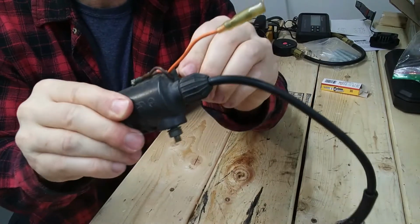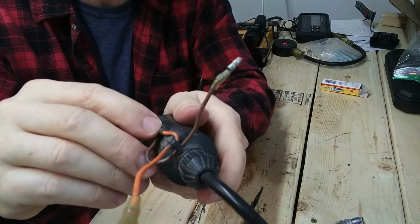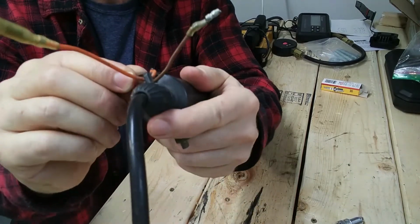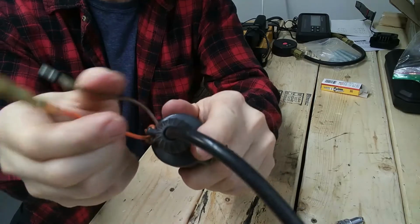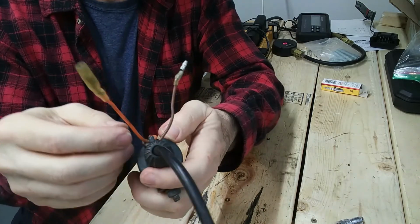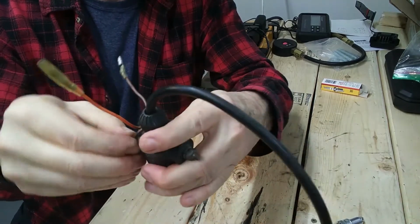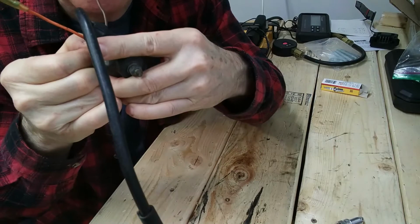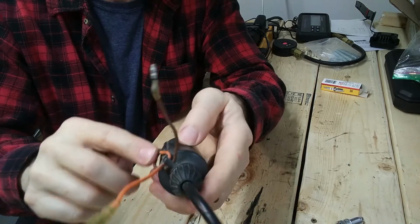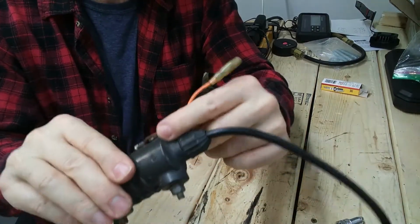And also I've noticed that this wire, very bad design, comes around and the plastic touches this metal part of this wire. So if you got some vibration and rub-through on this brown wire, you could have a short there, and it would cause this coil not to run right, especially if it was intermittent, and your bike would be running like crap, and you'd be looking at it, and you could probably measure this, and in the right circumstances it would pass, and it would fool you. So with wire, just check, especially on older bikes. This one's got a tiny bit of wear in there, but it's not through. Just a bad design, very bad. So I'd clean these up and give them a shot of sealer, actually, so you wouldn't have any arcing going across here. Anyway, that's the particular design that you have.